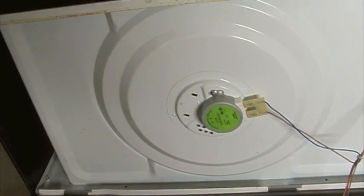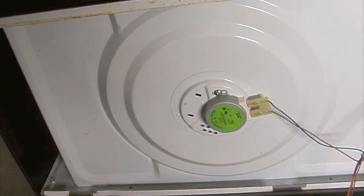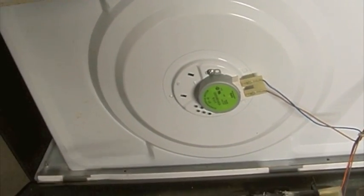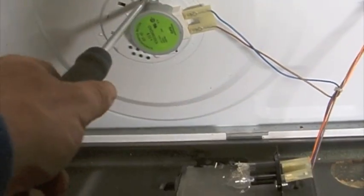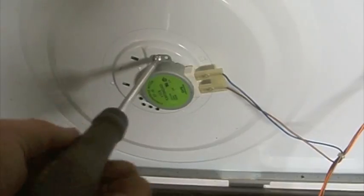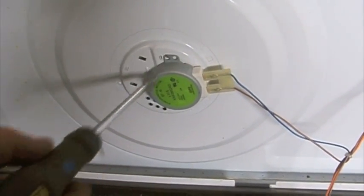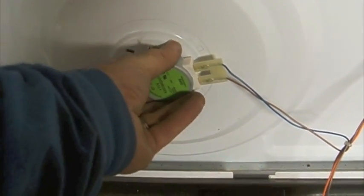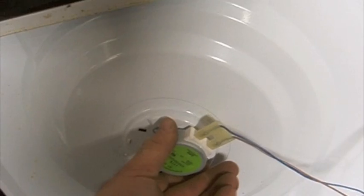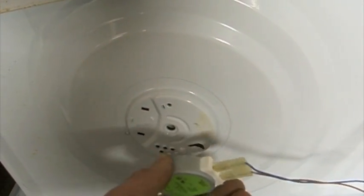The whole pan will drop down. If you're working underneath your stove — or above your stove — this would actually be a simple one to get to. There's one screw here that you're going to undo. The coupler is still on the inside, which attaches to the microwave plate, so that'll drop off when I pull this. This one's slotted, so you can spin and pull.